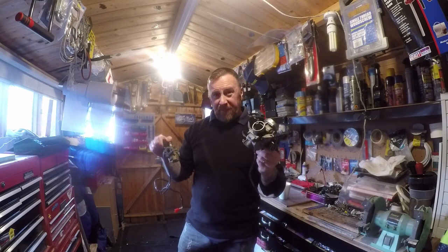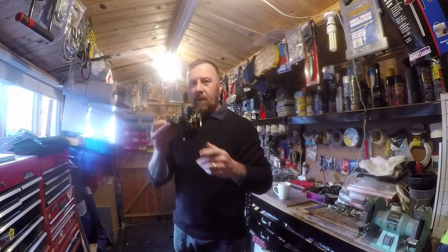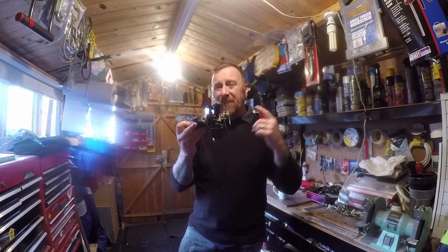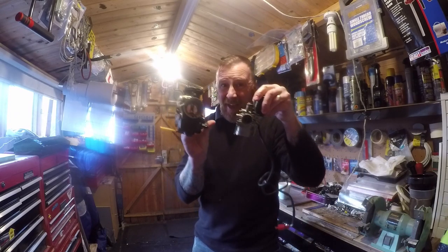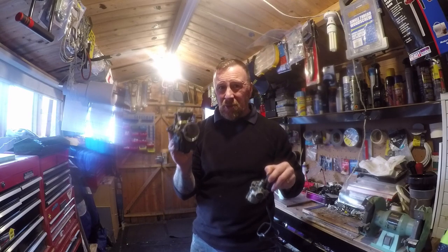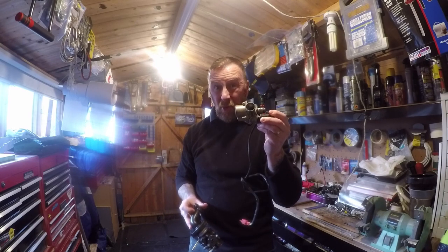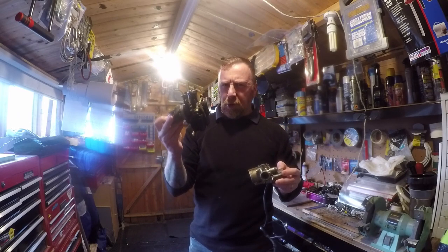Short little one on a 50cc — comparing 50cc carbs for 2Ts and 4Ts. This is a performance carb and I've done a video on this performance carb. It's massive, and this goes on a 50cc. Now that is a different entrance — I think this is 21, 23mm, I'm not 100% sure, rather than the 17.5 you normally have. Big difference — a lot more speed, but a lot more tuning.